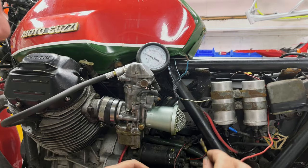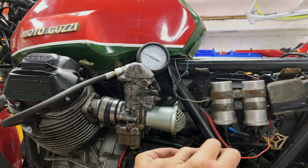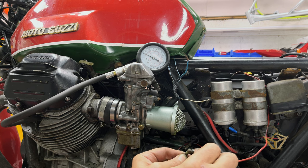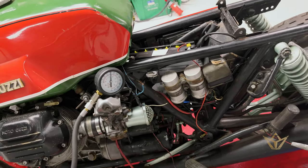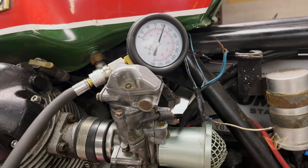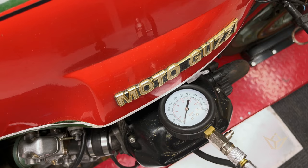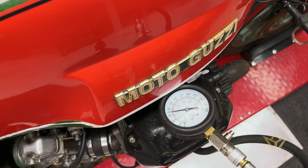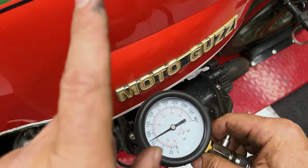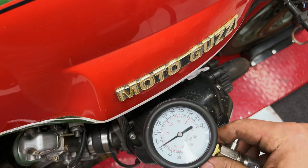So it was hot-wired and I've just reconnected everything. The reason why it wouldn't spark was because the earth was not absolutely hammered down tight. We're sitting at just over 100 PSI on that cylinder. The other one is about 85 — it's leaking off a little but not terrible.